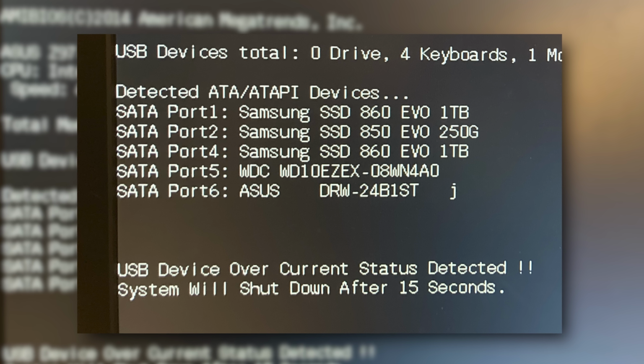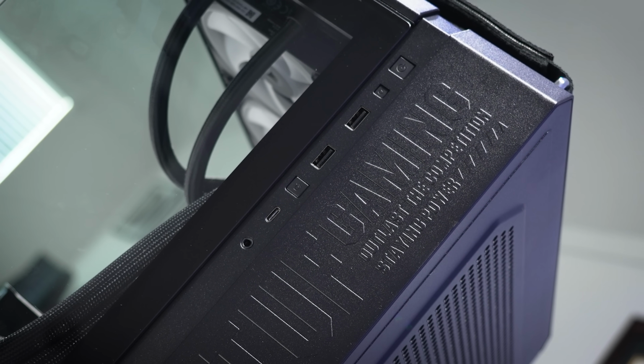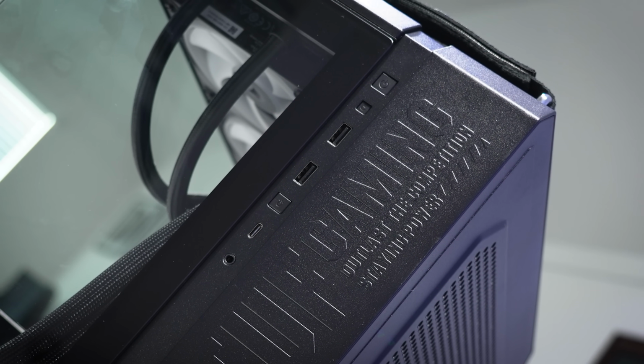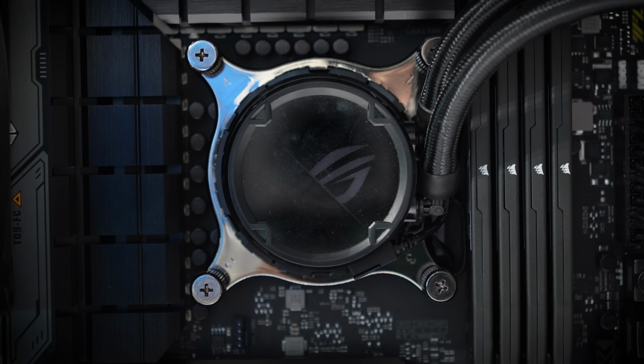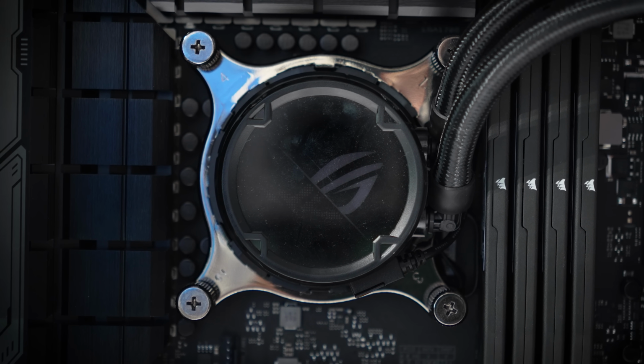If I recall, the last time this occurred in a rig, the Type-C cable running from the front panel of the case was bad. Either there were some wires crossed inside of the insulation, or the actual physical connector, the female side, was inconsistent. It's actually very nice that motherboards throw these kinds of codes.